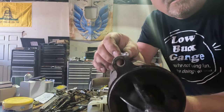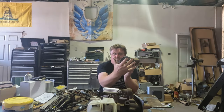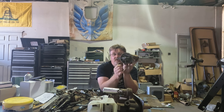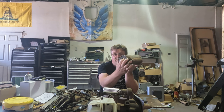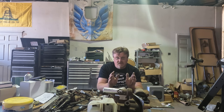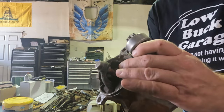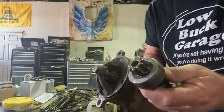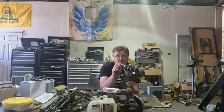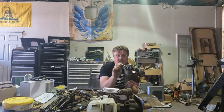I knew it was going to be oversized and figured the bolts would hold it in place — they didn't. Both bolts slid all the way to the side of their holes, so there wasn't enough engagement between the teeth of the starter and the flywheel teeth. It wore off the tops of the teeth and no longer turned the motor over. That mistake cost me $13 including shipping — I had to buy a new starter drive gear. I'll also put some bushings in the holes to make sure it can't move and keep it in alignment.